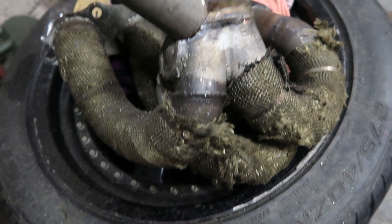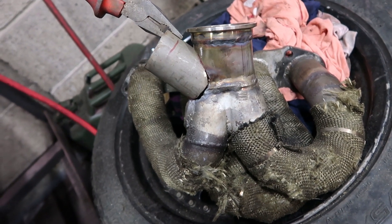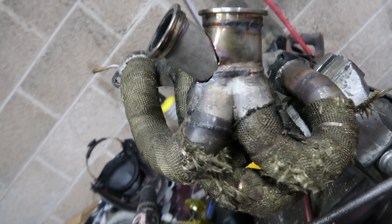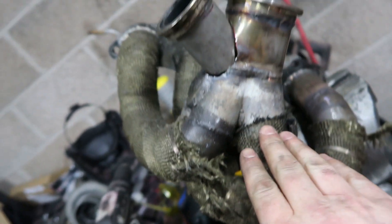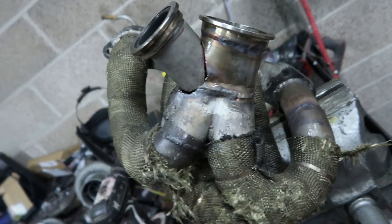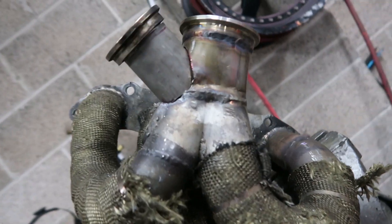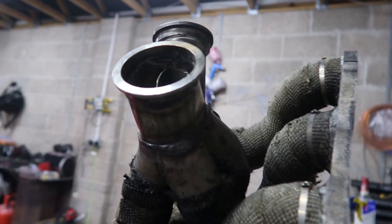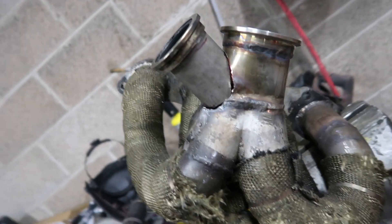I cut out this bit of pipe and that fits like that. That should be good for flow. It's not tacked on yet, I'm going to tack it in a wee second. Both runners are going to go in that direction, it's the right sort of shape. You're going to have to ignore how rough it is, but that's going to work a treat. Every angle, it's going to flow absolutely spot on. And we shouldn't get any creep with that.